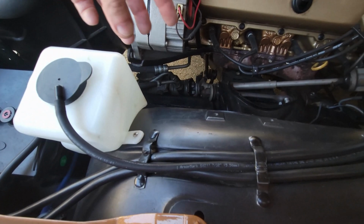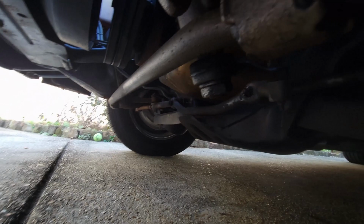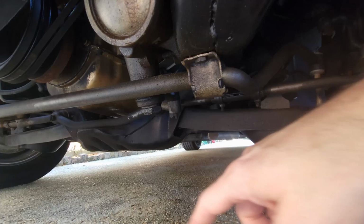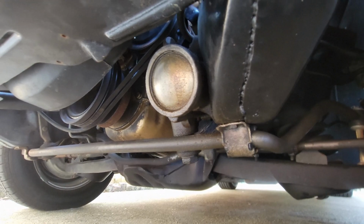So there's my steering box. You get the rag joint, two hydraulic hoses. I believe there's three bolts that bolt to the frame. And then underneath, you've got the pitman arm, which goes to the drag link. I'm going to get that off. There's not a whole lot to it, but you can see where it's leaking. It's leaking on this front cup, and it's hydraulic fluid here. It always leaves a little drip stain in a driveway, so I want to get that fixed. So I'm just going to remove this, and then next you'll see it on the bench.